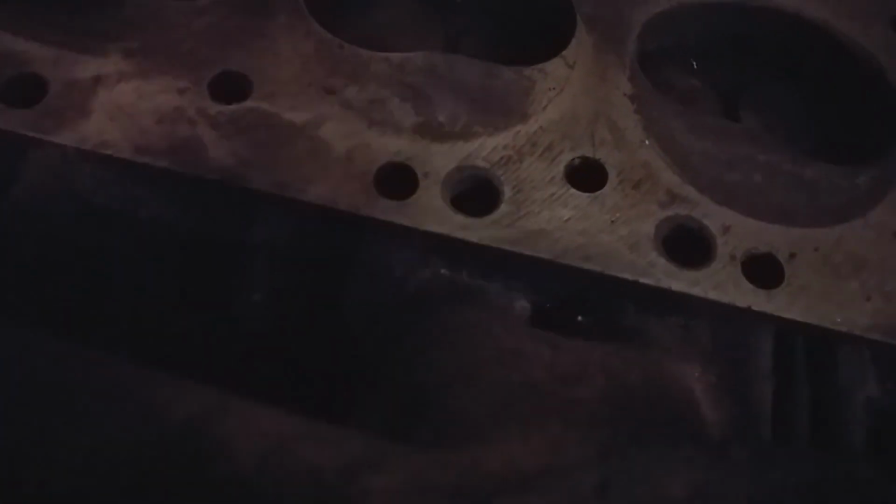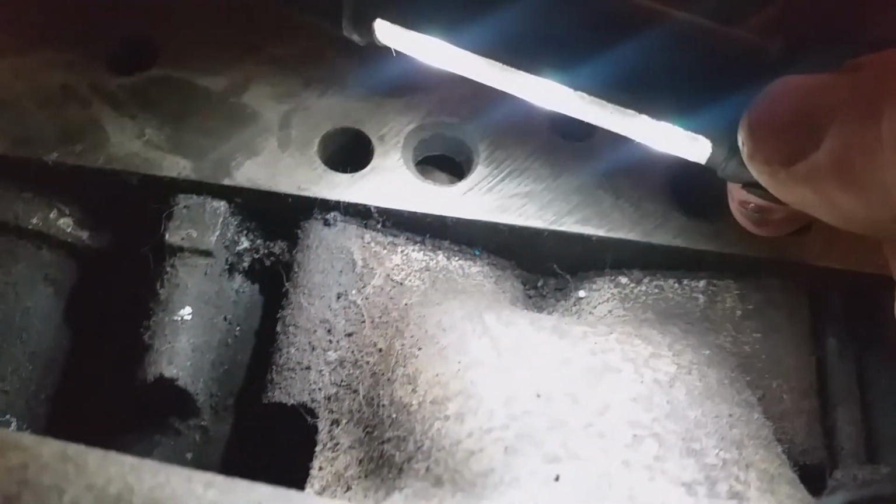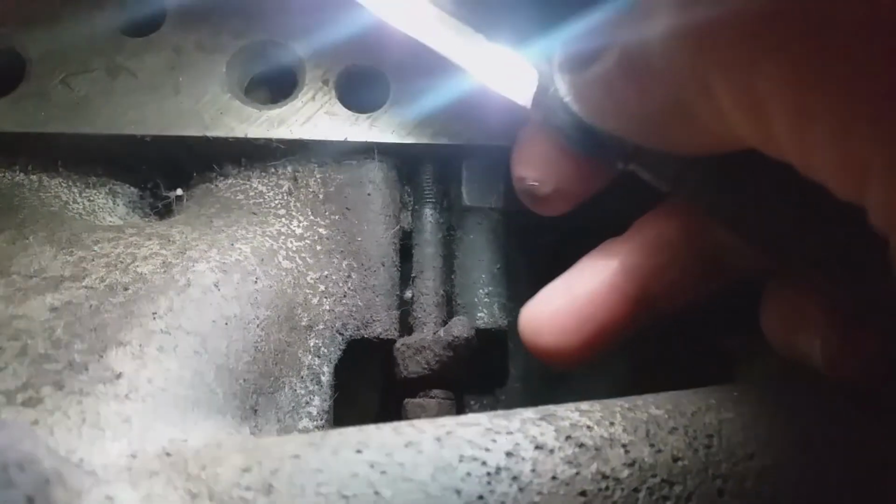So what's of note is where we've got that clamp, it goes in that sort of slot. Let's have a look at the other side. There it is. Now I've loosened it, so the clamp actually goes across those 2 faces rather than sticking up in the air like that. But that's where it goes. It goes either side of the inlet manifold.